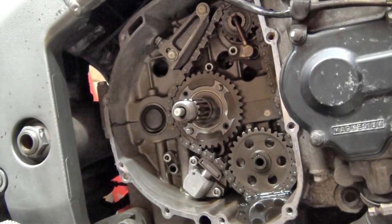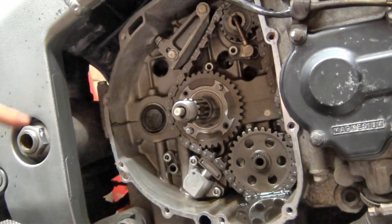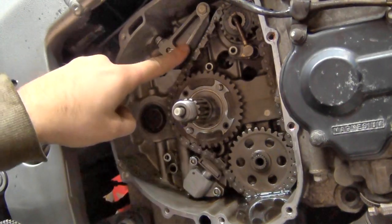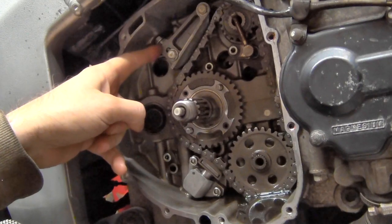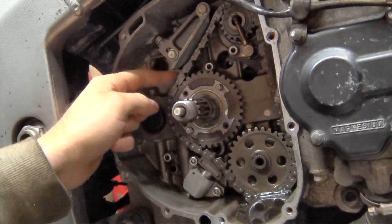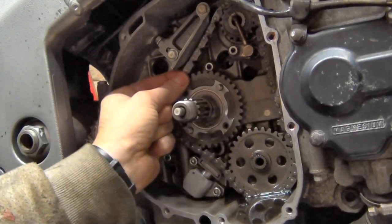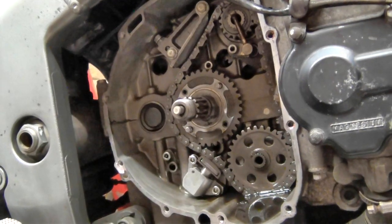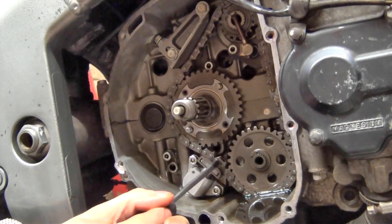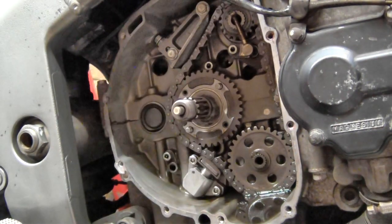Here we have the auxiliary chain, also called the alternator chain. It has two tensioners: a bottom one and a top tensioner with a slide. There's a nut and bolt for adjusting tension - depending on the bolt position, the tensioner gets closer to the chain making it tighter. There's currently some slack, and the bottom tensioner has a little movement which might be causing rattling noises at idle.